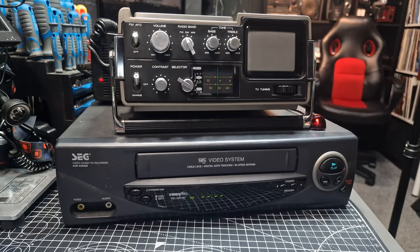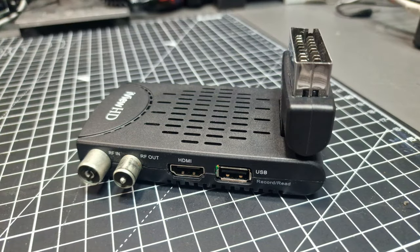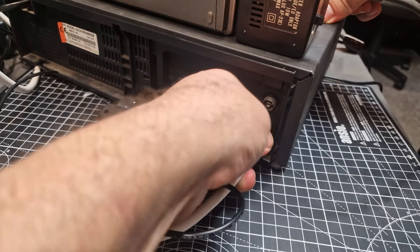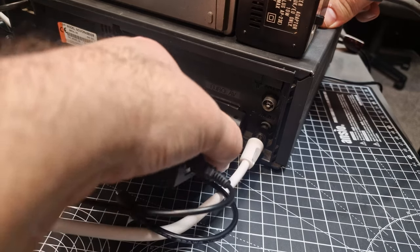As there are no longer analogue TV signals being broadcast in the UK, to get any picture on this TV I've chosen to hook it up to my VCR using the external aerial connection on the right-hand side, which plugs into the RF out on the back of the VCR. This means I can play any video on the TV screen. If I want to see live TV, I can use a Freeview device, which plugs into the VCR using a SCART plug and the VCR converts this into an RF output the TV can display. I can't plug it straight into the Freeview device's output as that would only work with a digital receiver.